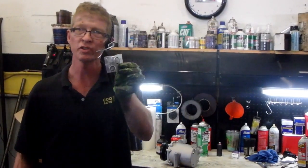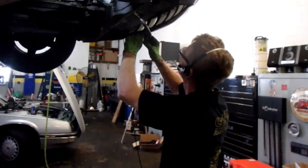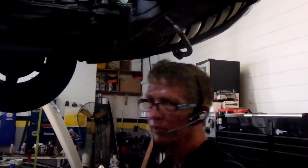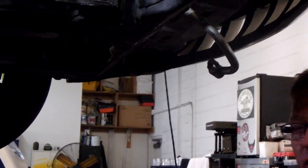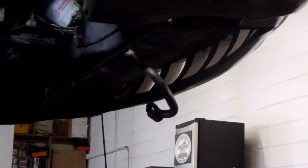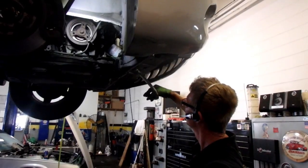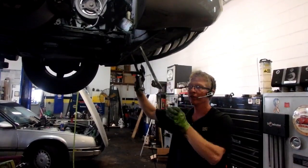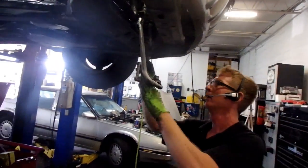Got new sealing washers. I'm going to put these sealing washers on these lines right here before I put everything together. May make it a little easier on the top. There's one worn out sealing washer. Take a closer look at that oil leak too. There's the sealing washer. Set up over your line. High side line now can come down here too. We don't want to leave them down here when we're putting our compressor in, and you're not going to get them back up in there.